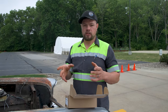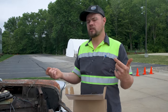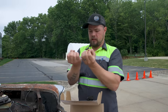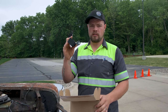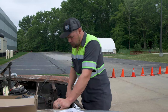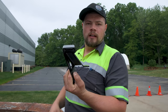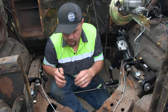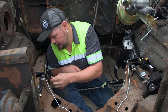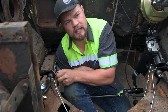While Robbie's helping Justin build the motor on Summit's channel, I'm outside making holes for the new engine mounts. The old style — called horse collars on Fords — had a big U-bracket bolting to the front of the block with rubber mounts on each side plus two rubber mounts at the bell housing. The new LS motor doesn't mount that way, so we're putting in actual modern-style motor mounts. To do that, there are two rivets I have to grind off and punch out, then drill two holes on top for the top mount bolts. I'm also removing the brake line mounts so I can move the brake lines away from the rivets — even the smallest heat will cause a pinhole in a brake line and then the brakes won't work. Time to grind the rivets away.